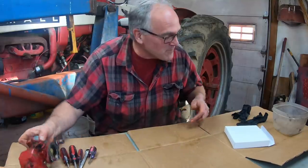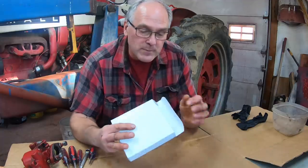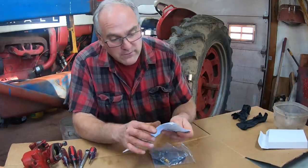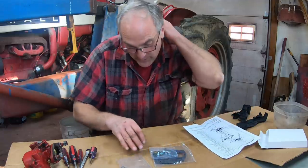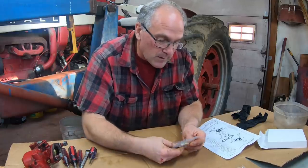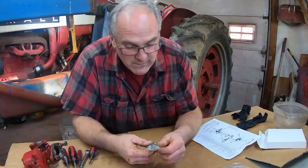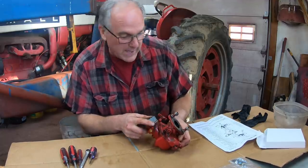It's nice to have a clean surface to do these carburetors. I got my carburetor rebuild kit from McDonald Carburetor in Georgia, and I'm always real happy with the quality of their kits. It's not the super-duper rebuild kit because this is an oddball carburetor. For an A, C, H, or M you could get a kit with the butterflies and butterfly rods, but this kit basically consists of a set of gaskets, the needle valve and seat for the float, the jet, a bunch of seals for the choke and throttle shafts, and another needle valve. I always like to have the kit before I start disassembling so I know what has to be kept in good shape.